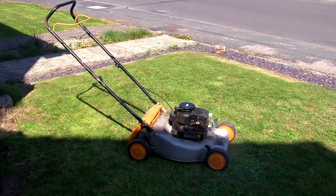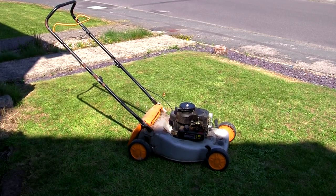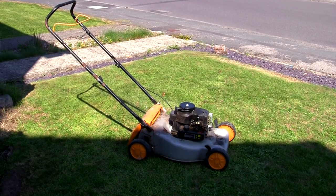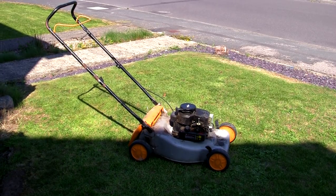I've just had a nice smile off the lady driving past. This looks like it's going to explode, but you can probably hear it's running really well. As I've mentioned in loads of videos, this white smoke probably isn't a problem at all — it will burn off. It's just because there's either too much oil that's been tipped up; I had it tipped up to check the blade. Within five minutes of running, this will have gone. So I'm going to leave this running and I'll get back to you, but as you can tell it's running great. It started up pretty much straight away once I put the spark plug cap back on.